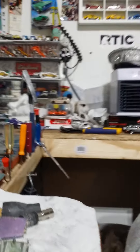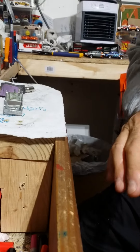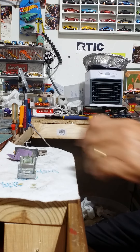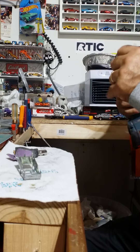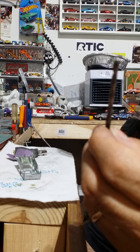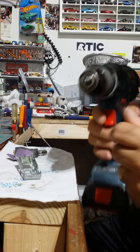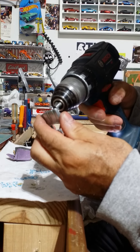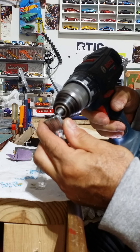Here's a little episode — I'm doing a drill-out on this tap and drill. This one's off the phone, here at Simple Customs. I drill the pilot hole with a 5/32" bit, then I come back with a number 50 bit, and I get it down just right for the screws.